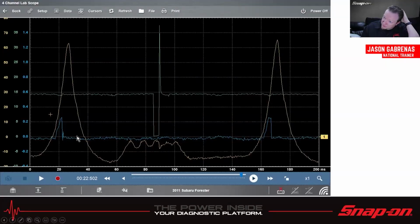Goes up, comes down. Get our valve overlap. Comes in, get our valve overlap here. Exhaust. Exhaust goes up, 1, 2, and then my fuel injector fires right before my intake valves open. Got a little overlap there. Comes in. Now you can see my pattern gets a little different over here, doesn't it?